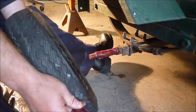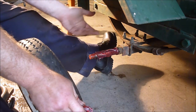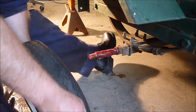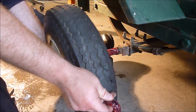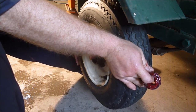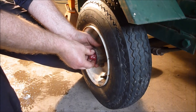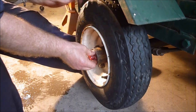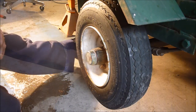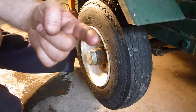Here we are back at the trailer. We're going to carefully slide this on — I went ahead and greased this when I did the other side. Sliding that on as far as it'll go, then you're going to put your front bearing in. Make sure everything's riding on your bearings. Please rate, comment, and subscribe. This is Sam, Jack of All, Master of None — you all have a good one.